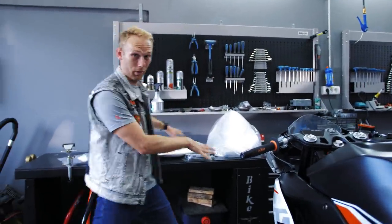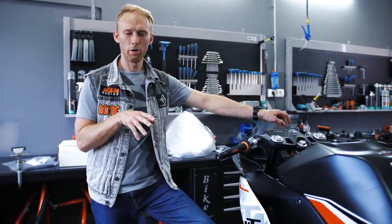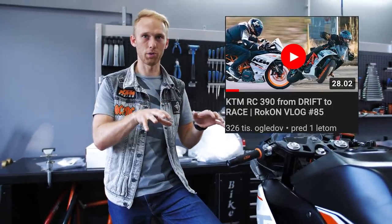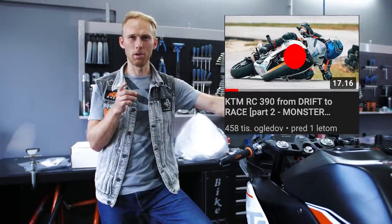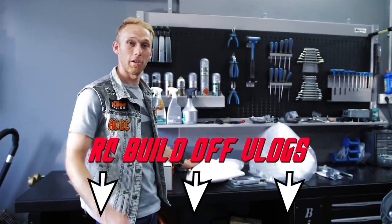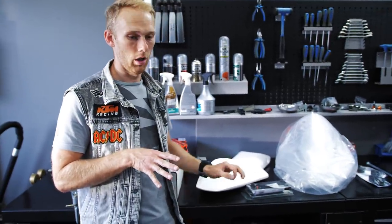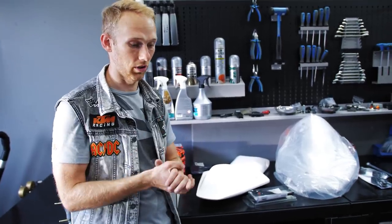Okay guys, before we go to the parts behind me, just a small recap for those watching this RC390 build series for the first time. Until now we did already three build-offs, so three tunings. The first one, we took all the stunt riding stuff off, so the bike was already a bit lighter. The second was the suspension, front and rear, one of the biggest time improvements on the racetrack. The third upgrade was the race tires, the Avon 3D Ultra Extreme, again a huge improvement compared to a normal street tire. If somebody didn't see these vlogs, they can find the link in the description. Definitely take a lot of tips from those build-offs. Today we will improve the weight again, since we just took down the stunt parts in the first part, and now it's time to put a lot of race parts on the bike.